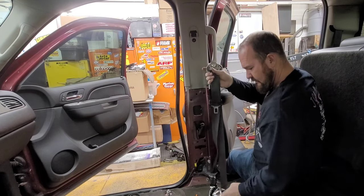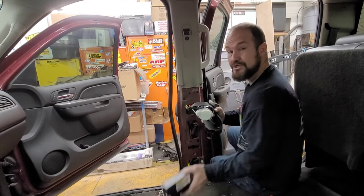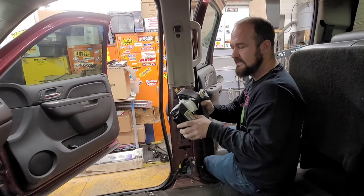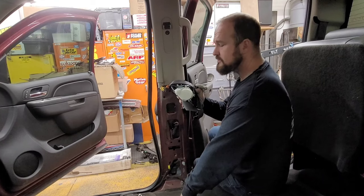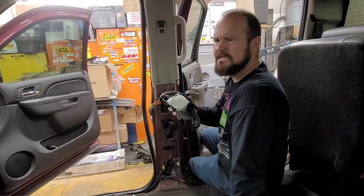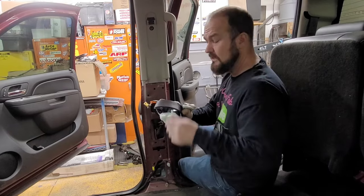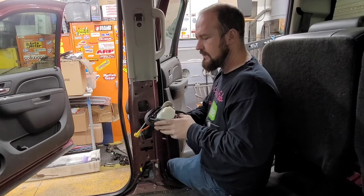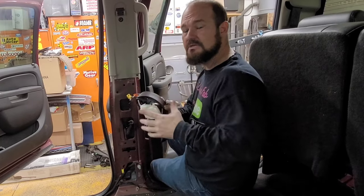I'll roll all this up and put it in a box and ship it off to Safety Restore, which also does airbag modules. I'm going to put this, this, and the other seat belt in a box. Once they get it they turn it around, rebuild the seat belts, reprogram the airbag module, and send it right back — usually about four days round trip. I'm very happy with them. They also change webbing — I had them change webbing in a square body truck a while back. Watch that video and all the other videos on replacing airbags, modules, and seat belts on my channel. Hit subscribe and stay tuned.